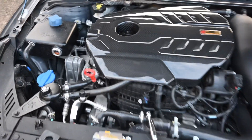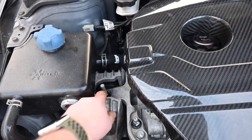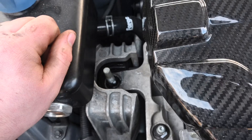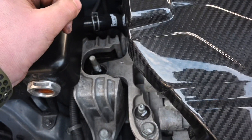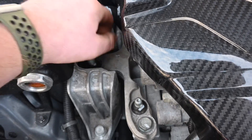As you look at the engine bay, you've got the upper right engine mount which goes on just here. The bush goes underneath that nut under there, so that is a 17mm, so we're going to take that off, and then the bush just slides over that bolt that's sticking out there.